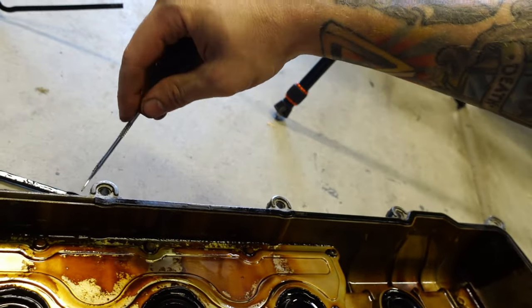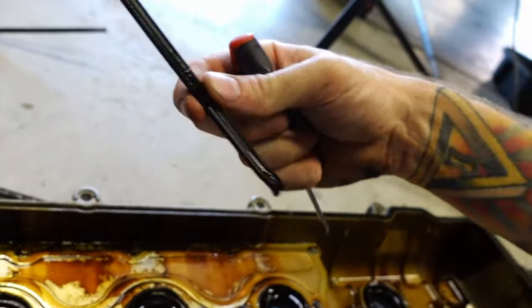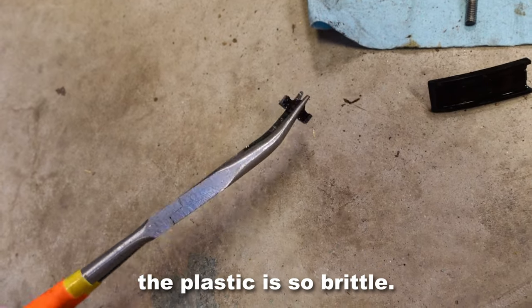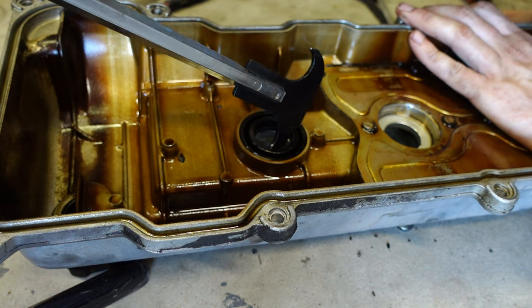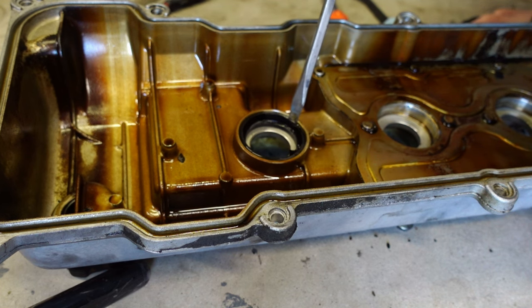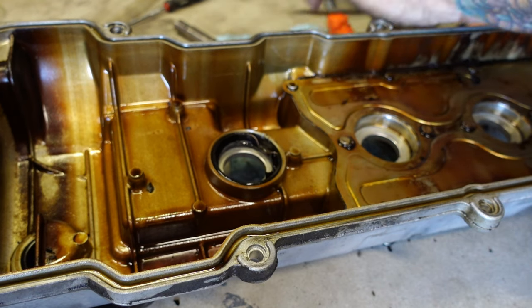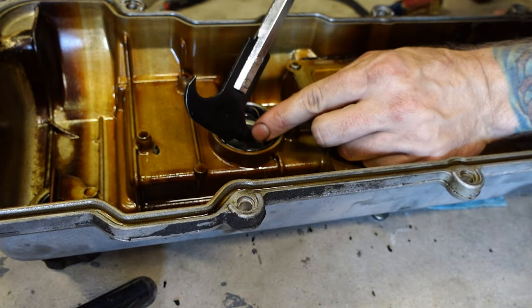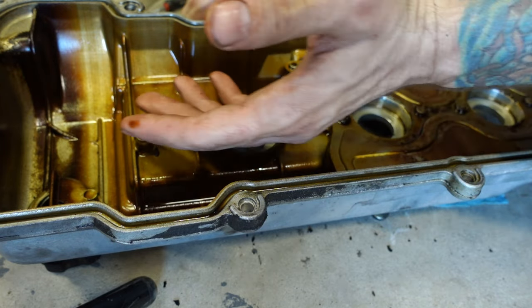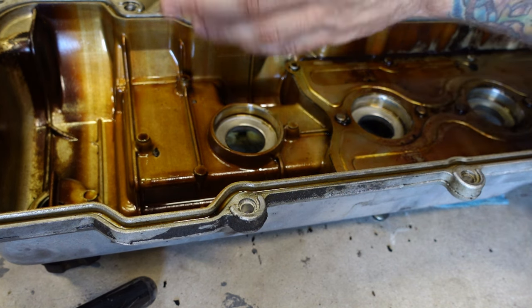As you can see, this old gasket is rock hard and definitely the cause of some leaks. Comment below if you've ever seen a gasket this dry or a seal this hard. They've all came out this exact same way — what I've been doing is hammering the lip down and basically using it as a lip for my seal puller to get them out. All six spark plug tube gaskets and the valve cover gasket itself are completely bone dry to the point where you touch them and they snap. Unfortunately, so is the timing chain guide.